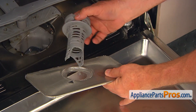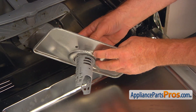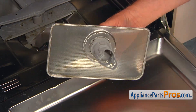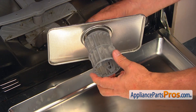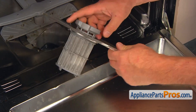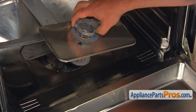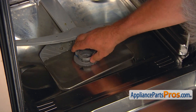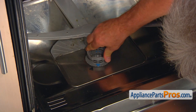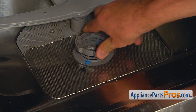We're going to bring the filter in, then insert the holder in and push it into lock. Then take the basket filter, lock it on, and install this into the dishwasher — push it down and turn clockwise until it locks.